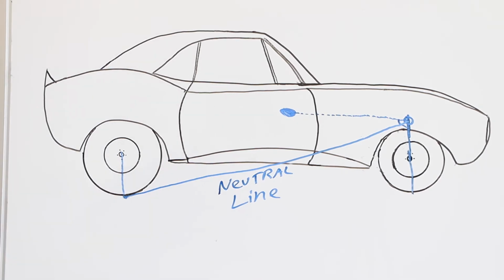I'm going to read a little bit more from this book. So, quote, how this line is positioned in relationship to the line of force that is thrust from the tire through the instant center and on into space helps us predict what kind of pitch rotation we will see. As you know, if you can control pitch rotation, you can manipulate load transfer and with that, traction.